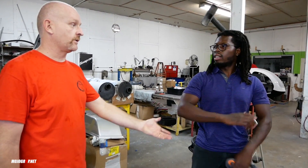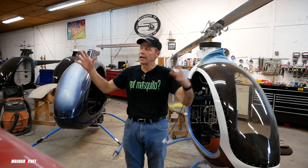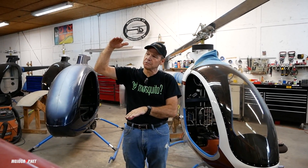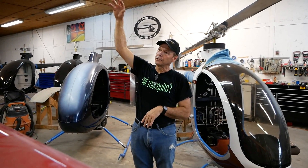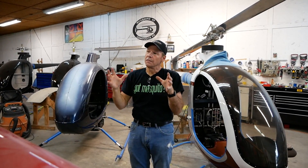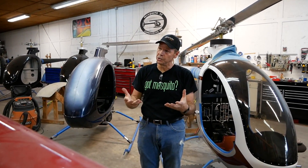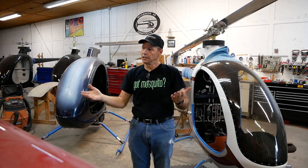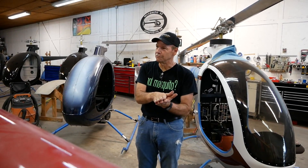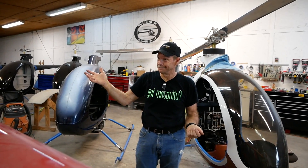To get off the ground you're in ground effects, so it's a little less than 46 horsepower. Ground effects in a helicopter extend to one and a half times the diameter of the rotor — the closer to the ground, the more effective. Out of ground effects you're flying strictly on vectored thrust, which is typically the most power you'd ever use. This machine can hover in-ground effects at 12,000 feet, and out-of-ground effects at 10,000 feet.